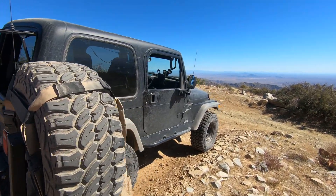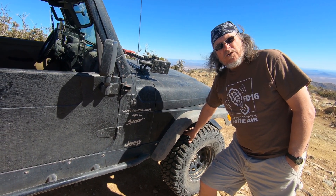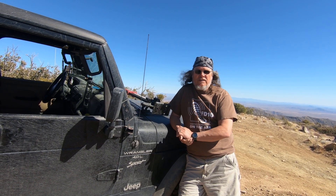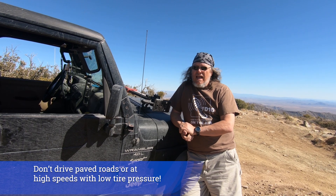One of the things that makes the biggest difference when going off-road is airing down your tires. It doesn't matter if you're in a Jeep or a pickup — when you're going down dirt roads taking bumps and vibrations, airing your tires down helps enormously. Today we're running about 16 pounds on all tires. Normally I run 35 pounds on roads, but as soon as I go off-road I drop to about 16 pounds. The advantage is your tires become an active shock absorber — you're not feeling every bump through the shocks, your tires are absorbing it. It also gives you significantly better traction. We came up a very steep trail and two-thirds of the way I was just in two-wheel drive, second gear, putting up it on these nice soft tires.